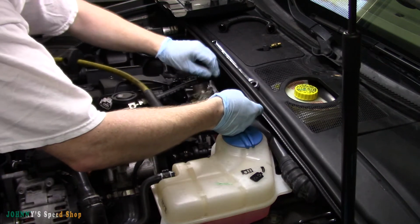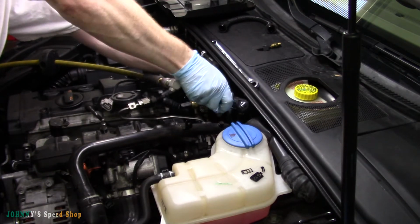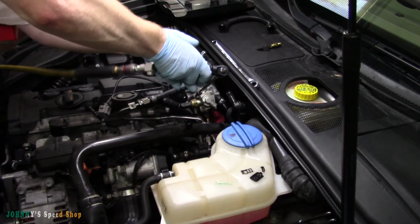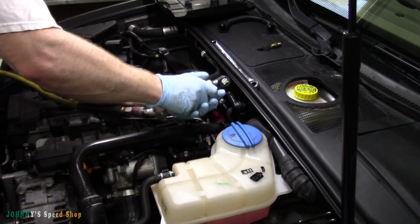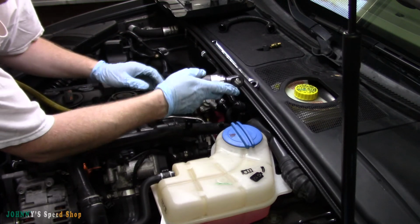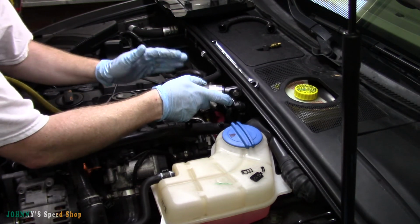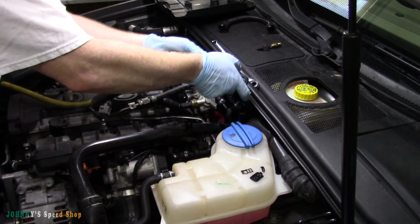I think I said these are a T30. Just in case this is under pressure, you don't want to take two bolts out and then take the last bolt out, because then it'll come out all crooked. Just crack them all at the same time, and then you'll see what's going to happen if it's under that pressure or not.